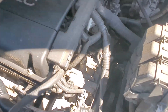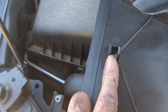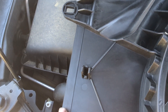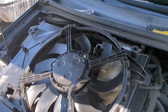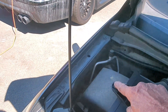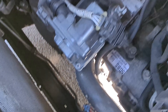We got it out of there. If you look down in here, there's a little clip with a pointy thing on it that goes into it. And on the other side, there's a transmission line — I believe those are power steering lines down there — that just sits in there. You got to get those out before you remove it. The trick is to pull out on it a little bit and slide it over. Once you get it loose, you can keep working at it and get it out. It takes a little bit of finesse — it doesn't come out real easy, but it will come out. Also, I said these were number 10 bolts — they're actually 5/16ths, not number 10s.